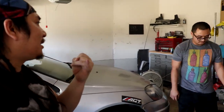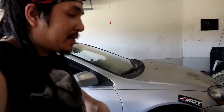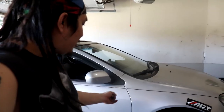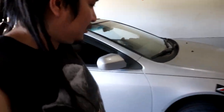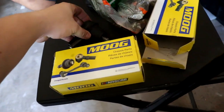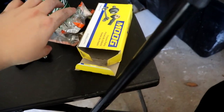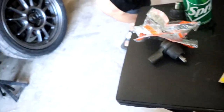But right now, today we are going to be rolling the fenders and doing the tie rod end links, because those are worn out. Eventually I'm going to get coils and lower the car, roll the fenders just in preparation for that. By the way, I'm also using Moog tie rod end links. I got them off RockAuto — they were pretty cheap and it's one of their more popular choices for tie rod end links for this car specifically.